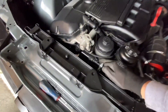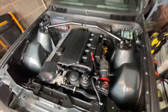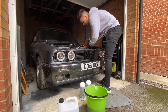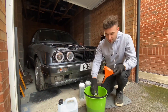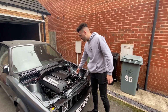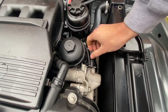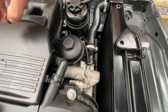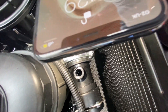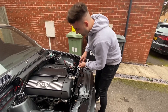Now we're going to take the little bleed valve off so we can fill the coolant into the radiator. We'll run the fans to get everything bled through. Right guys, the car's filled up with coolant - the expansion tank is full and the bleeder valve is full. If you look down this hole you can just see the reflection of the coolant sat in there. The car is all bled.